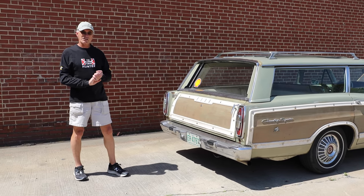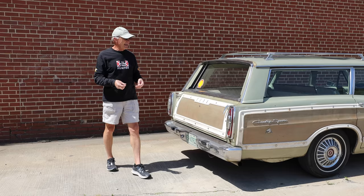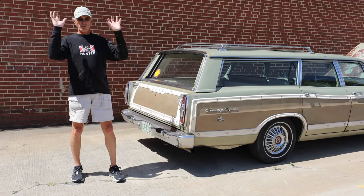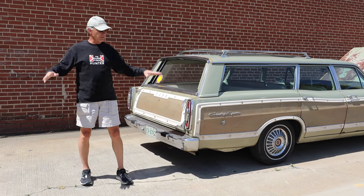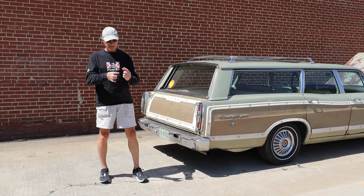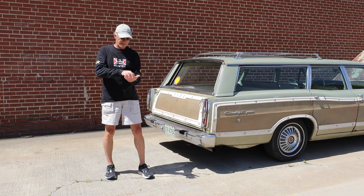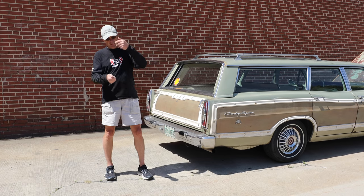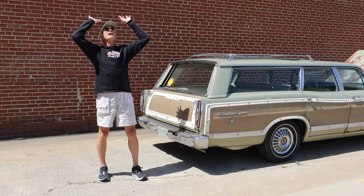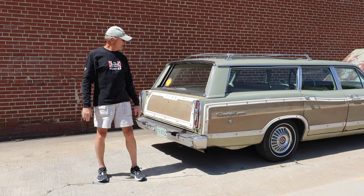The other big modification — well, it's not really a modification, it was more of a maintenance repair. We took the body off the frame. These station wagons, actually Galaxies in general, have a problem where there's corrosion underneath the car and frames can just break in half — it's happened. There are rubber biscuits that insulate the body from the chassis, and some of them had broken through the frame. So we picked the body up, welded up those spots, put new biscuits on, repaired a lot of the corrosion that had been starting underneath, and put it back down. This car doesn't have any rattles — it's really a good car.